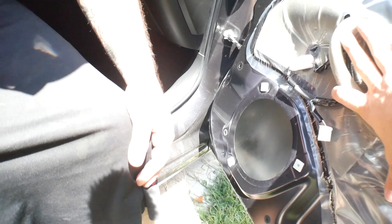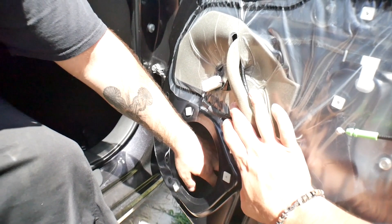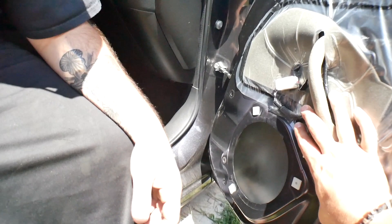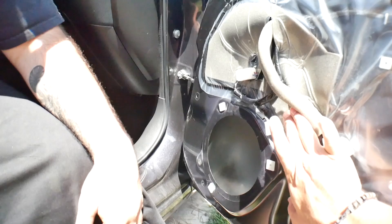We can see it fits, but we'll align it and also extend the wiring a bit since I don't feel comfortable with it being that close and short. On the topic of sound deadening, if you want a cheap Dynamat alternative, Home Depot sells a one-sided sticky silver-backed insulating roof insulation that works. It's been tested and costs a fraction of the price. It reflects sound but doesn't kill rattles the way Dynamat does — Dynamat's weight grabs the sound and deadens it.